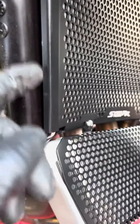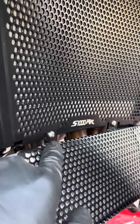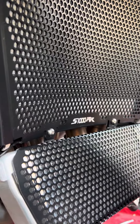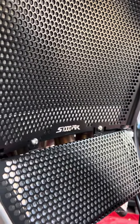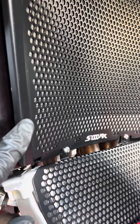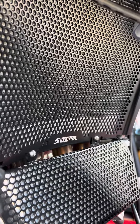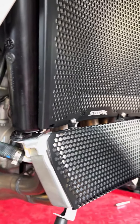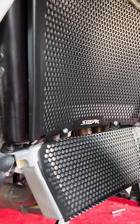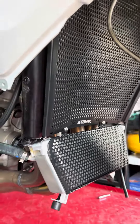Loosen the oil cooler brackets and make sure you fit these behind here, because there's a threaded holder for the bolts in this cover. That means you have to go through the radiator guard connector here — the back — and clamp that together. Then go ahead and put that in. I just want to give you a little tip on installing these, then tighten everything back up. Everything should be okay — good luck guys, have fun.